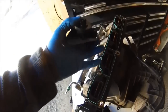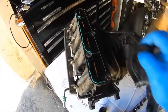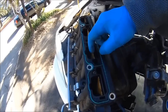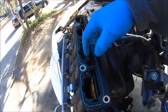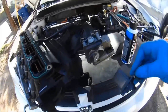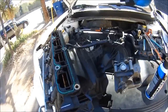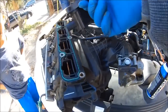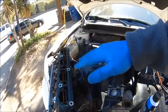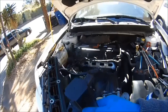First I'm going to clean it up and put it back on. I didn't have to pull all this off, but I had to see if these were really stuck — and they're not. It's just this part. This is what goes bad, and then they require you to flash the engine just to bring everything back to its original specs. There are certain parameters this has to stay within — a high and a low. If it goes outside those parameters, the code will set, which is the P2017 on this.